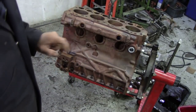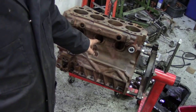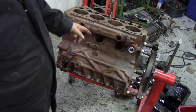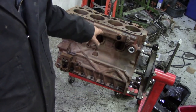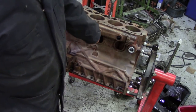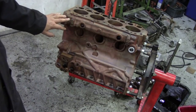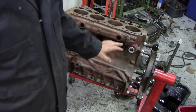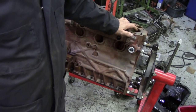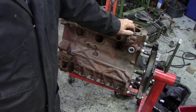The most important thing is this: inside all these cavities where there was a lot of rust, if you can remember, it's all gone. I think it was a good call to sandblast. I used 40 pounds of sand on this — a full bag. Because I've got my high-pressure nozzle, I could get it in here, all over the place, up, down, round and round. It's lovely and clean. But the problem is it went red rust. Am I bothered? No. Because I'm going to have to have this block rebored — it's too badly pitted from rust. That's not a problem.